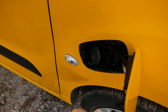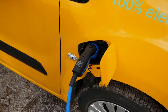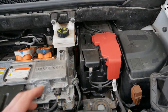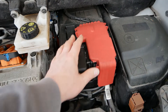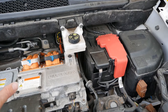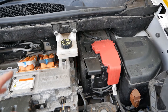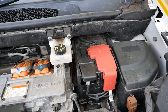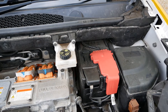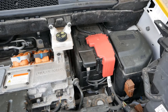The mistake people make is thinking that putting the vehicle on charge will solve the problem, but your electric vehicle will not charge if your 12 volt battery is flat. Electric vehicles are just like combustion engine vehicles — they're completely reliant on that 12 volt battery to start. They're not cranking over an engine, but they're running all the 12 volt circuits, all the ECUs, your dash, your central locking, and also enabling the contactors which switch on the traction battery under the floor. So if your 12 volt battery is flat, the electric vehicle won't start or charge.